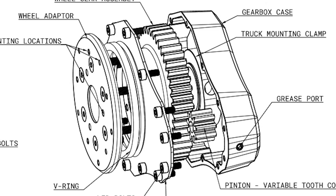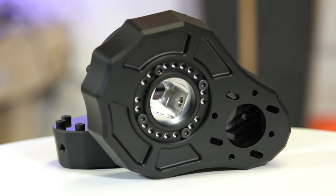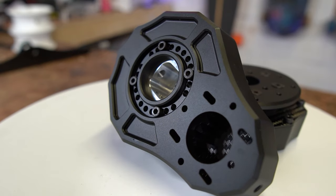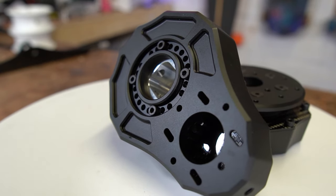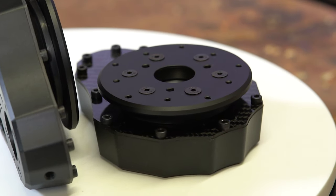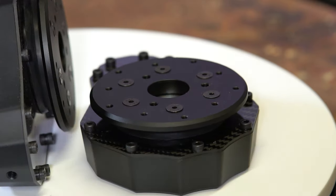Then possibly the founding father of gear drives, Jens Kappel from Etox, came up with a gear drive. A gear drive is two pinions — one rotates the other — and the relationship between those two gears determines the reduction in gearing and therefore the top speed and torque of your build. Up until now gear drives have been very expensive. But enter the Moon drives — precision engineered gear drives at a super affordable price of just £260, made of precision CNC'd 6061 aluminium, 3K carbon fibre, carbon steel and delrin wheel spurs.